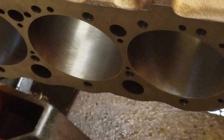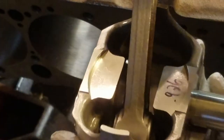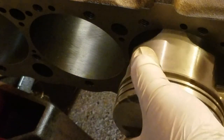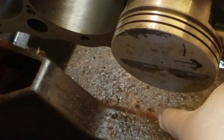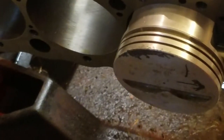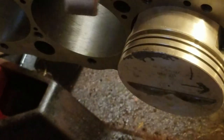Chevy 400 part 4 - piston and rod assembly. Here's my piston and rod. This is how I figure out which way is forward: the valve reliefs always go towards the lifter valley, which is down here, not the side of the block - they always face downward. I put an arrow here and this is number one piston, so that's the front of the engine.